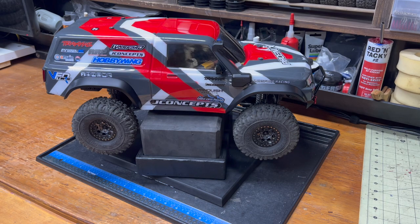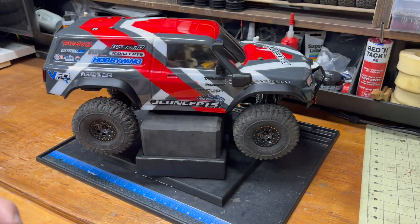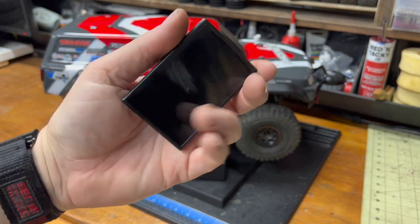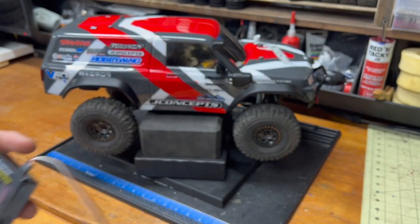I went into the program card and set everything back to its default positions on the Pro. Where the Pro differs specifically from the old Quick Run is it's got different settings. The 1080 — mostly what most of us know from Hobbywing — does indeed have 15 programmable parameters. But famously, the Quick Run Fusion had just nine. The Pro steps that up to 13 programmable parameters.